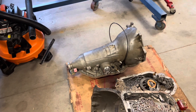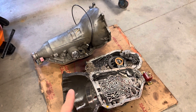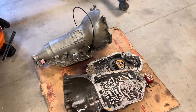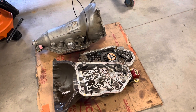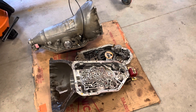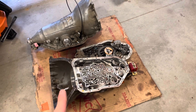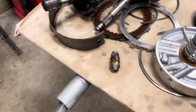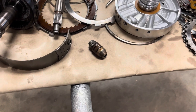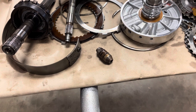I'm pretty confident in this transmission, so I said screw it and just tore it apart. It seriously only took me about 45 minutes to tear it apart. The valve body was already off, but the separator plate and the one-two accumulator were still on, and the pump was already pulled. What took me so long is the bullet for the speedometer was seized in there — I got it out but it's completely ruined, so I'm going to have to find a new one.